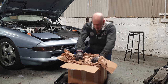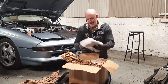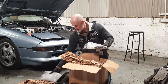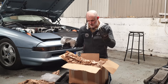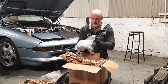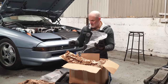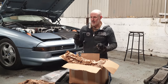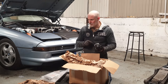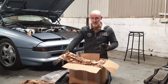Three weeks later, all my stuff is back. I sent quite a bit to Wolf at Woke Performance in Germany — including both engine computers for testing. He plugged both DMEs into his test car — he's got an 850i over there, countless 850s. He basically pulled the codes and the DMEs had nothing stored on them at all. Interestingly, the car actually cranked but didn't fire up initially, but after a bit of plugging stuff in and out, the car started up just fine. So the DMEs appear to be okay.